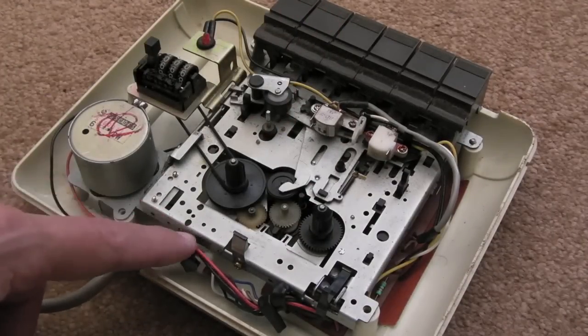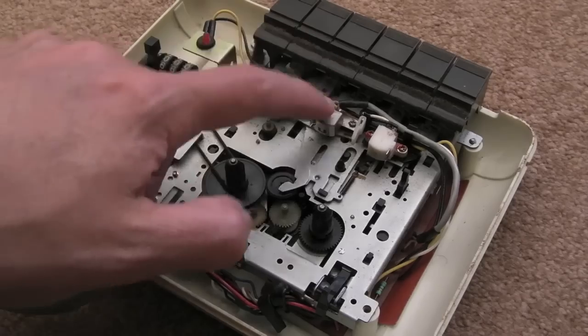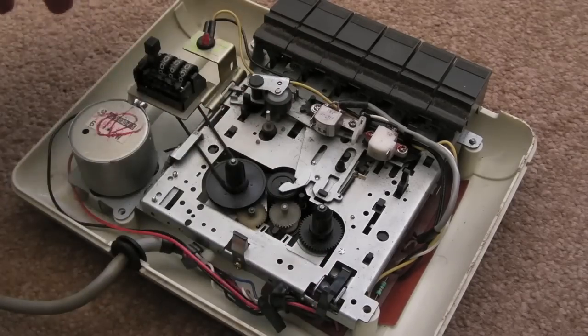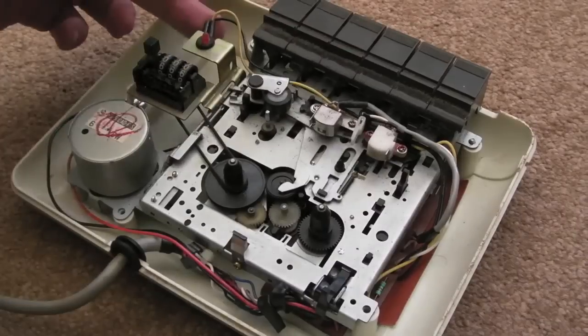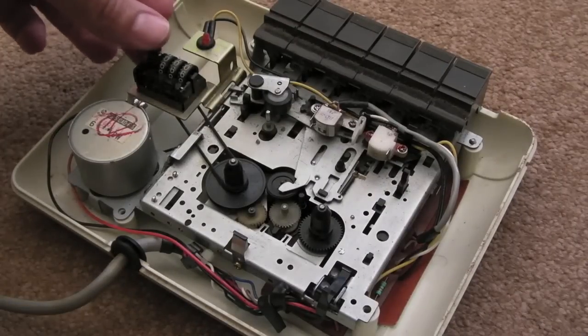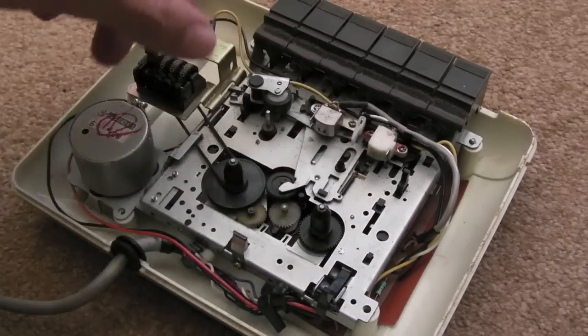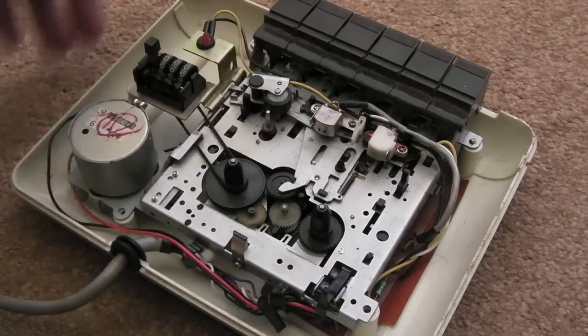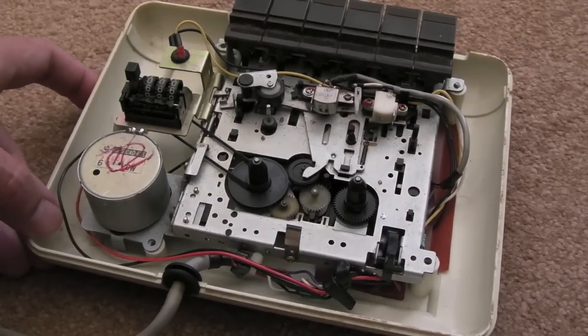For what I'm doing with this, I'm going to have a tape head that's going to transmit the signal to the tape head that's already there anyway, so it doesn't even matter if this rotates. It's pretty dirty — you can see all the dirt on the buttons and things. I'll wipe the tape heads down with some isoprop as well. Not going to use a tape demagnetiser just yet because I don't think it needs it.